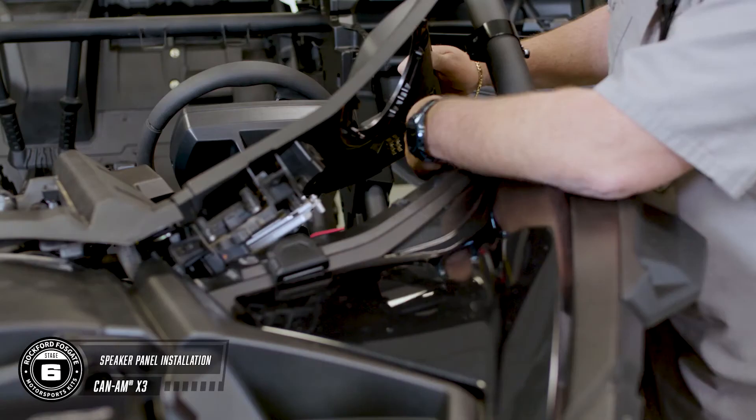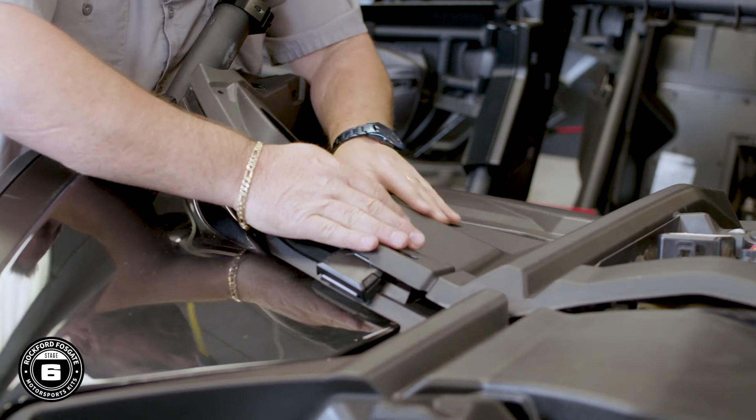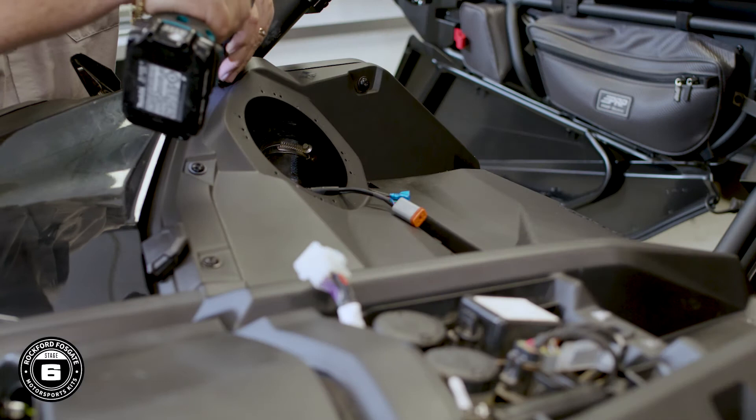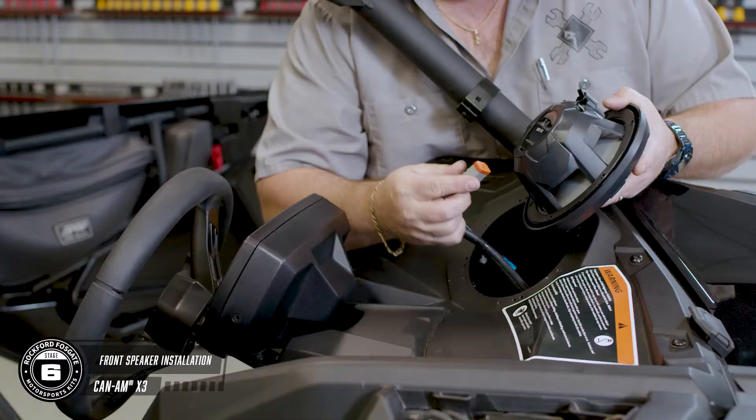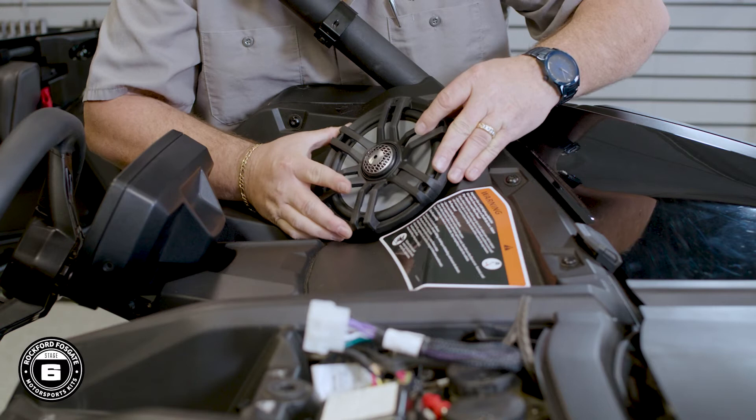You're ready to install your new front speaker panels. Start with the driver's side and reattach the smart lock harness, being sure to push in the red locking pin. Now reattach the headlight and any other accessory switches. Move over to the passenger side and seat the panel back into its original location. Now you're ready to install your speakers — plug in the four-pin Deutsch connectors for the Color Optics feature. Connect the speaker wire by attaching the red wire to the positive spade lug and the black wire to the negative spade lug. Position the speakers to the number three hole on the panels and secure using the included 3mm bit and supplied hardware.